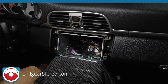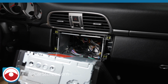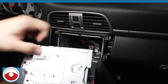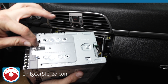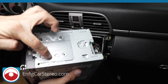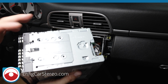All right, guys, so now I went and got the radio. I went and saw one of my old videos. So we've shot this video before. I just never liked the way it came out, so I've never put it up. On this mounting bracket from the back, in the video I said I went 4 and 6. So we don't have good instructions for these when you buy them, but what happens is you attach this bracket and you count the notches, so 4 and 6 from the back, and you mount the 2 screws, and then this holds this to the radio, and then this locks the radio in.